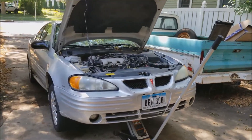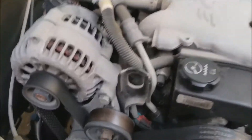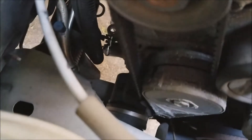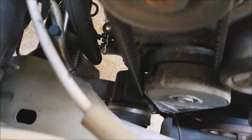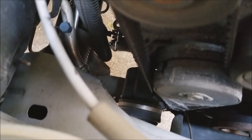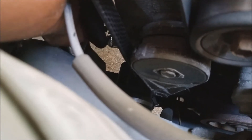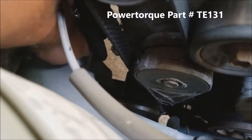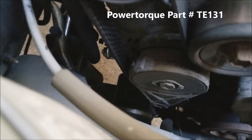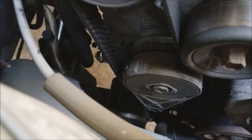Today we're looking at a 2002 Grand Am with a 3.4-liter V6. The speedometer is not working and I'm getting a code P0502, which typically points to the transmission speed sensor — that sensor right there on the passenger side, right by the CV axle on the output side of the transmission. It's a pretty easy replacement, about a $12 sensor, but I've already replaced it and that didn't fix it, so we're going to have to do more diagnostic work to figure out if it's wiring or something in the transmission.